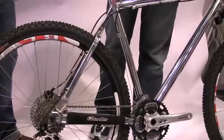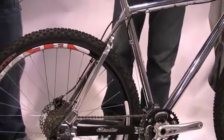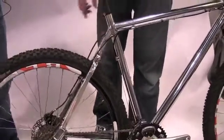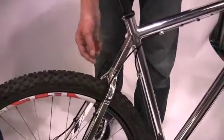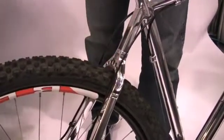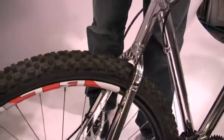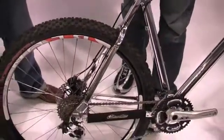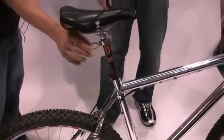Right. So the yokes serve as, I guess, a good way to say, a tuning fork. Tuning, right. Tune the ride. Basically, they're long. The aspect ratio is kind of narrow and long, and there's a large weld contact along those planes for strength. But you end up with kind of a long cantilever that you can use to allow the frame to flex.